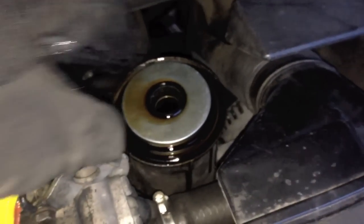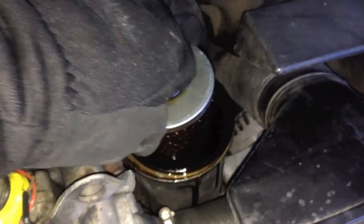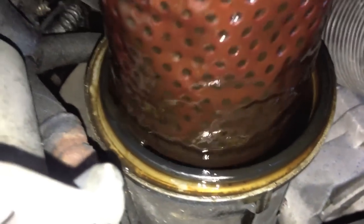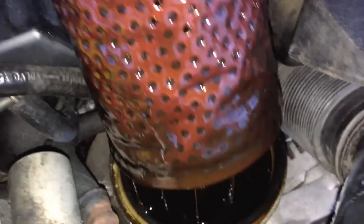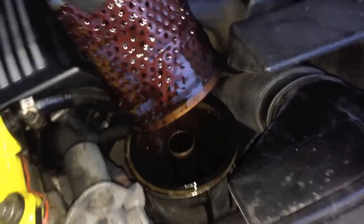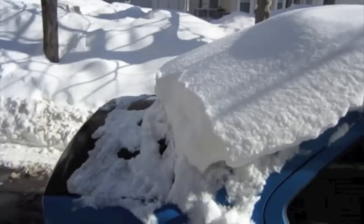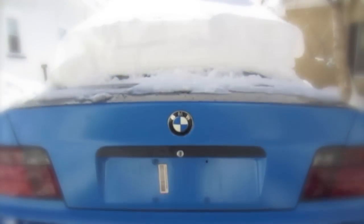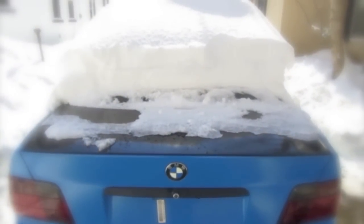The motor doesn't sound too healthy, right? We didn't think so either. So we decided to open up the oil filter housing and take a closer look, and what we found was just nasty. Brand new oil that looked like honey five minutes ago was now this thick brown sludge, and there were chunks and flakes of old oil everywhere — the brand new filter was completely clogged. Now even just idling gives us an oil warning light, and if we don't come up with a plan of attack for this oil problem, this motor is not going to last long at all.